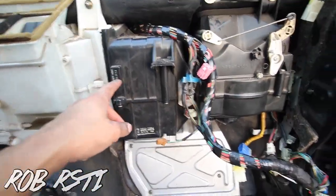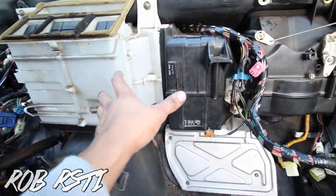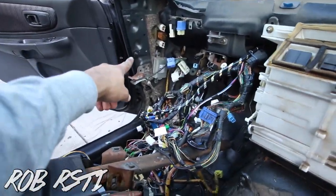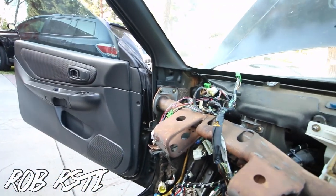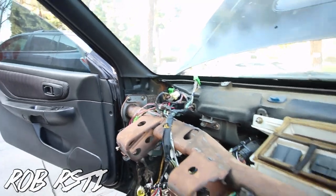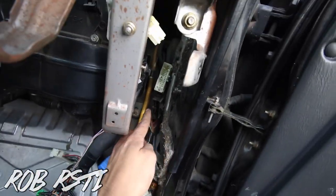Now I want to put in your heater core and your blower. I hope you guys labeled your bags or your bolts — it's one, two, three down here, same thing for this one, and then two in the bottom right there. Once that's in, I'm gonna be putting the bar — it comes from the passenger side, goes through those two studs coming out right there. The bar is in with just two bolts right there and right there, with the grounds, and then two nuts and two bolts at the corner. Once that's in, I'm just plugging in the right side with all the plugs here.